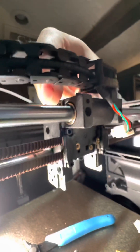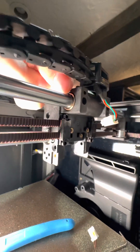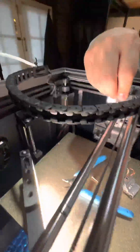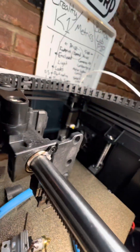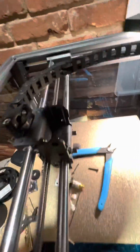Build quality looks great. The only thing I haven't confirmed is whether or not these brass bushings are sintered bronze or sintered brass. There's a type of bushing that has little bits of oil embedded into the bronze itself — it's a porous metal with some oil in there. They provide grease for you to apply to these rods. You can see the residue on these rods is black, which might indicate that there's some oil being released from these bushings, because the grease that I applied was clear slash white — like that white colored grease that looks just like lard if you're into cooking.